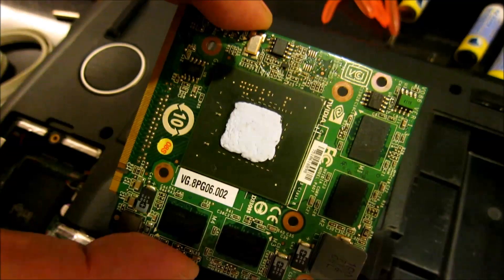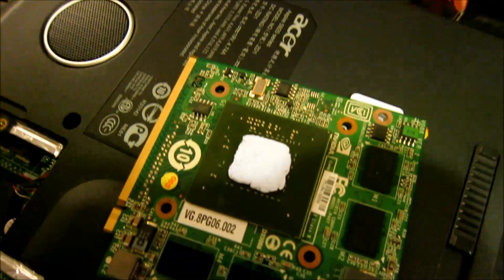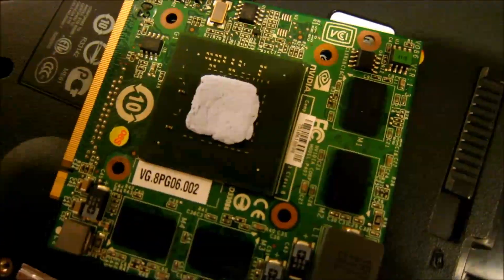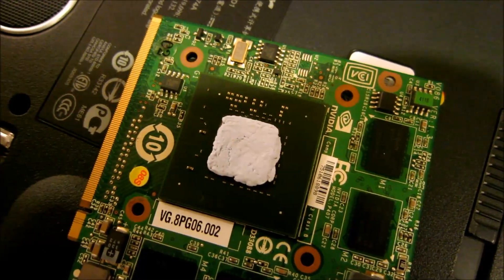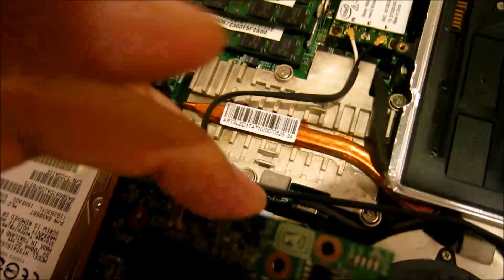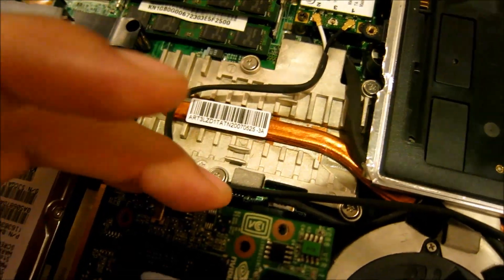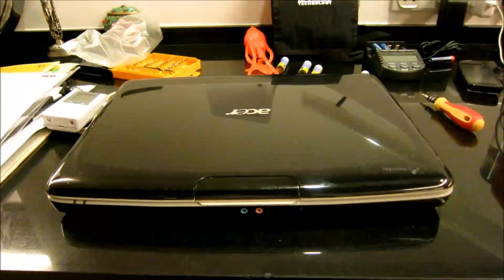Just a little trick: I've used a plastic bag here, covering my finger in that plastic bag to help spread the paste around and ensure it's covering every little corner of the chip. Now what we're going to do is take this chip, pop it back into the computer, and fire it up and see how it goes.